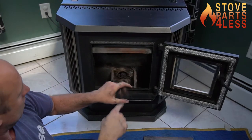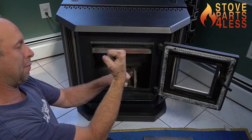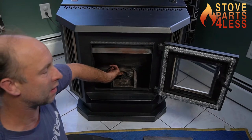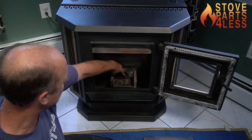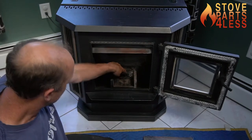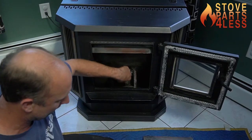When it does, this middle edge will force the auger to go up and scrape along the top of this. If you hear noise when it's running, it's usually because of the carbon buildup there. That also puts a lot of stress on the motor in the back. So it's important that the carbon on the bottom of this ring be taken off.